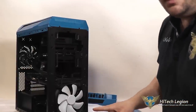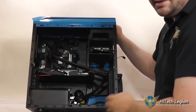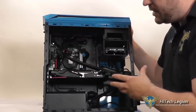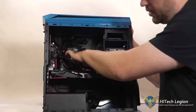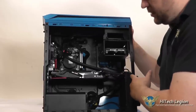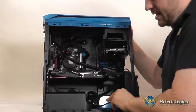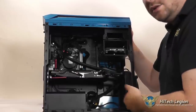There's also one on the bottom — I'll show you those with the accessories. We've got a full system in here; this is a mini ITX system, but it also supports micro ATX boards. I actually think it would work better with the larger micro ATX board because you'd have a little bit more spacing between your cables. Right now it looks a little crowded because that's where all the connections are on this motherboard. We've got our tubing running over for our CPU cooler, and we've got a full size 280X graphics card in here with plenty of room to spare — so there's lots of room for extra fans in the front or even longer graphics cards. There is another hard drive bay installed on the bottom by default; I did remove it to make installation easier.